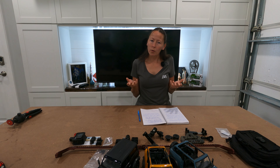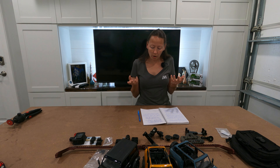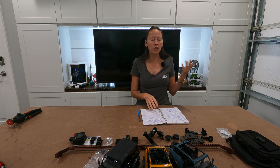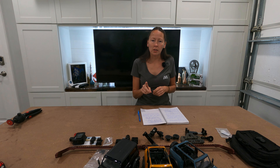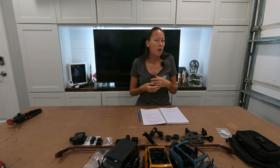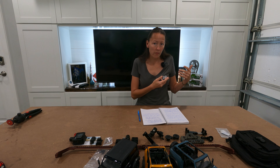The 2021 and 2022 Bronco Sport also has a recall regarding the 1.5 liter engine only — so if you have a 2.0, you can skip this part. With the 1.5 liter, there are three cylinders affected. The engine oil separator housing may develop a crack, which could cause an oil leak that could lead to a fire. That's the recall.